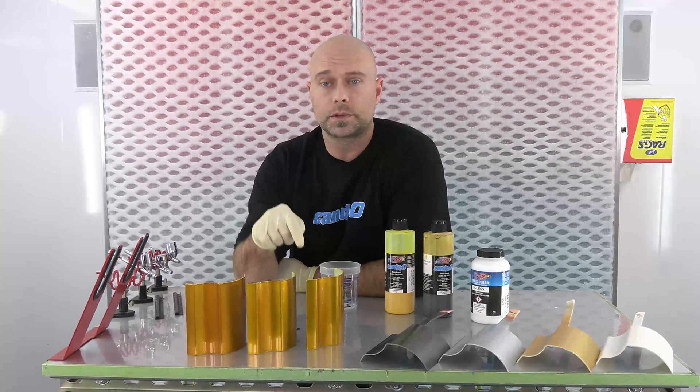I'm going to strain my candy before I pour it in here. I use the PPS 2.0 system from 3M — love that system. It has a strainer built into the lid at 200 microns. But since we're spraying candy, which is very thin and extremely fine, anytime I'm mixing my candies I use Gerson 125-micron filters. I don't know if you can see the tightness of that mesh, but it is very tight. I recommend 125 microns for the candy. The 4050 is hard to pour through this strainer, so as I add my candy I'll pour it right through — it's a lot easier. It's just that last protection before you start spraying, and it's going to catch what the 200-micron cup strainer won't.